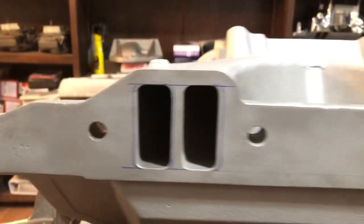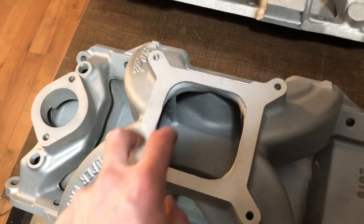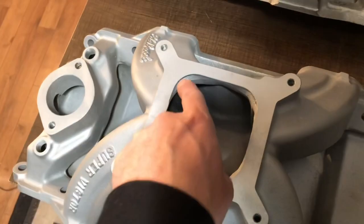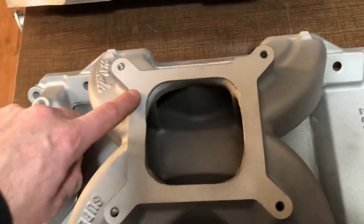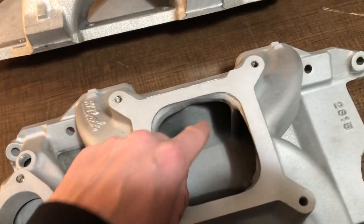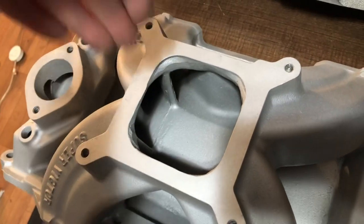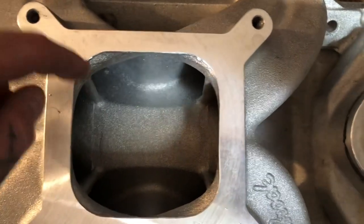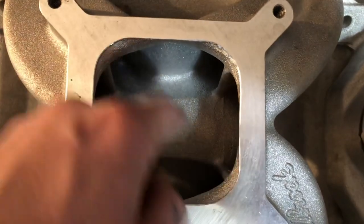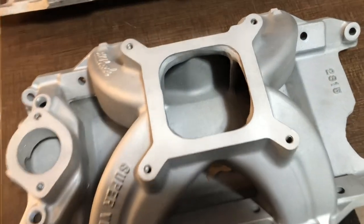With both sides laid out, what I'm going to do on the inside: most guys when they talk about the plenum just talk about line of sight — making sure the carburetor has a good sight line directly to the cylinder head. So simply cleaning this area up and rolling that down into the ports is where my main focus is going to be. I'll take off some casting flash as well. I'm not going to go crazy up here, but I'll basically clean up what they did and try to pull some material out to make a good trajectory right into the cylinder head. You can see on the stock ones how much it bulbs out. Let's get off to the shop and start making some chips.